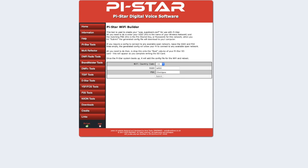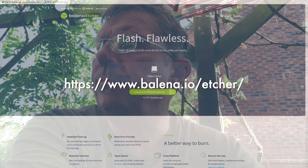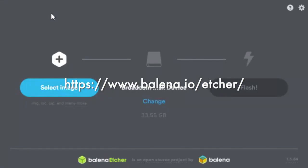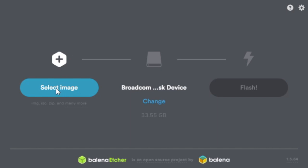Once you have both the Wi-Fi download and the operating system, you then need to go to another website. I think it's Etcher — I download the installer. It's basically an SD card writer. You run the program, find the image you want to install on your SD card, then hit start and it will write the PiStar operating system to the SD card.